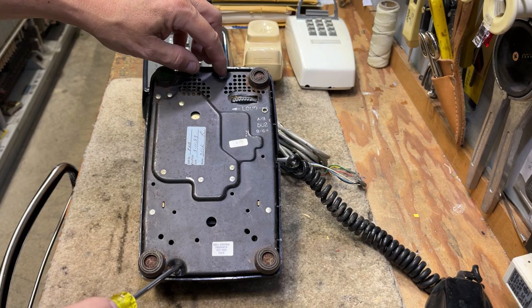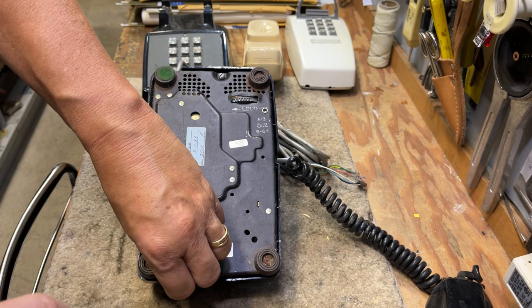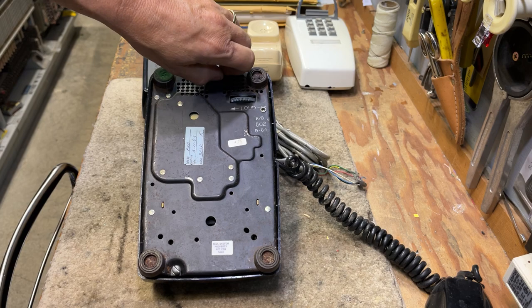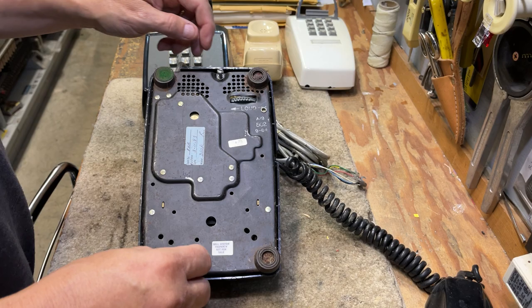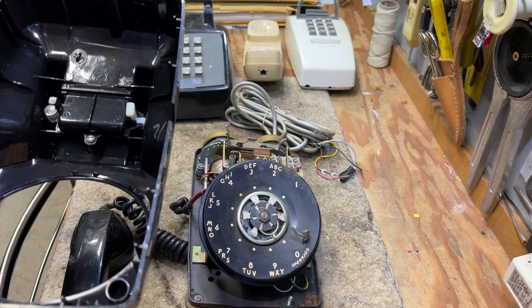In order to gain access inside the phone, there are two screws — one down by the bottom foot and one in the back. You loosen these screws until you can pull the housing. The screws generally do not come out on Western Electric phones; you have to put a little additional effort into it, and there's no reason to take the screw all the way out. ITT and Stromberg screws just fall out because they didn't have a double thread on them.